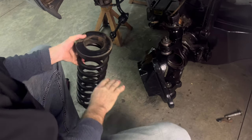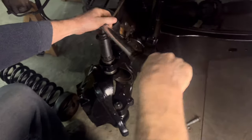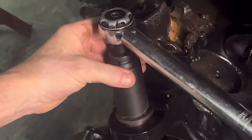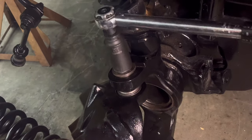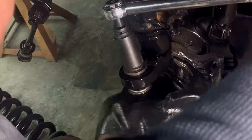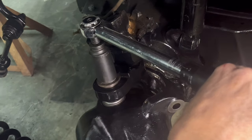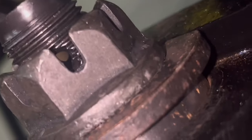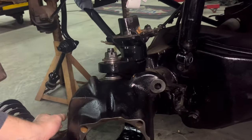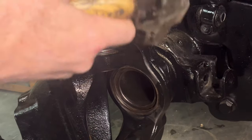I need to go paint that now too. Remember why we lowered it — so that when I put this torque on here it doesn't touch the spring. I can get all the way out of the way. That spring is right there and I think it does mess with your torque just wiggling around. He just double-checked the torque setting on the torque wrench. Okay, that's done. Now look at the hole — we need to go forward a little bit. Do not go backwards. Go a little tighter so that lines up. We've got a little bit of unhappy on this one — this one's a little tight. I have 44 and 69 done, now we're going to go to 150.